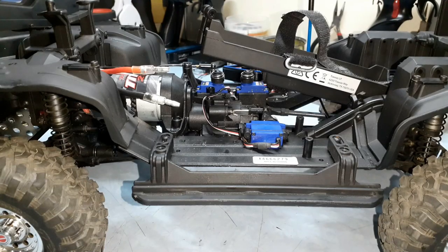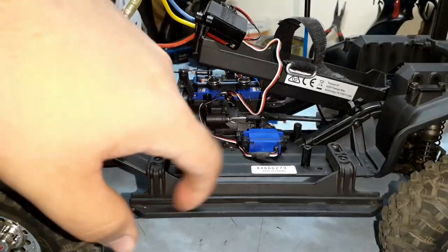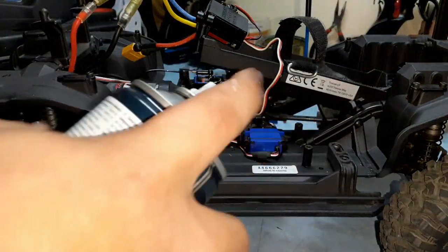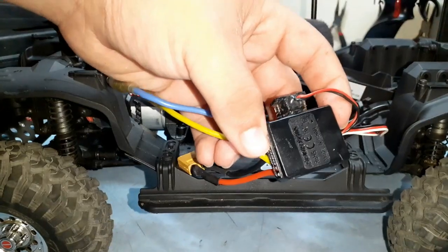Okay guys, back at the front. Good tip that should help here: there could be oils on the plastic, so we're going to have to degrease the surface. What you have to do is get some brake cleaner, put it on there, and quickly wipe it off.